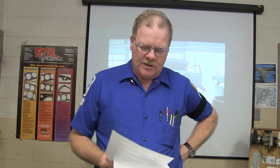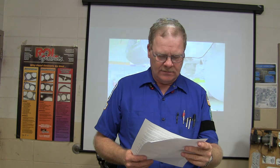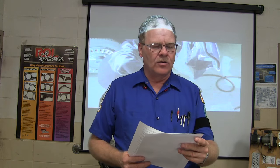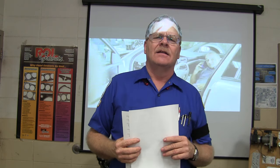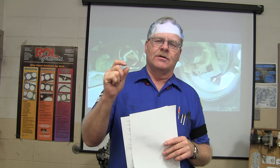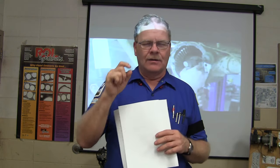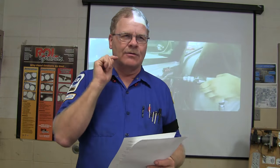How many sensors must be triggered at the same time to cause an airbag deployment? That's sort of foggy. Yes, two. Technically two, but a lot of them have just got one airbag sensor that's built into the module for the forward slap. In the olden days, the airbag sensors had a little gold plated steel ball that was stuck to a magnet, and it had a tunnel. Down at the end of that tunnel, there were two wires. If you hit hard enough, it would break that ball loose from that magnet and roll down there.